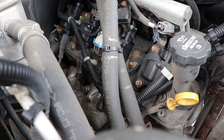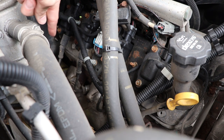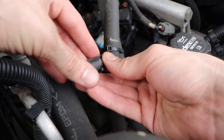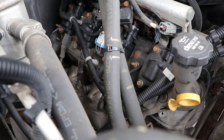The passenger side is going to be the same process. We're simply going to replace one spark plug at a time, and in this case I think I might start from the back because that's going to be the hardest one to get to. There is a heat shield down here at the bottom, and we're going to have to use one of these universal joints for your socket in order to make the bend. So we're going to put this on the socket, make the bend around that shield, and then we'll be able to remove the spark plug.